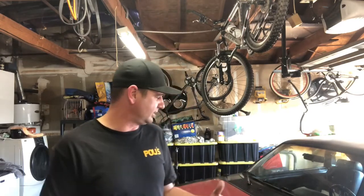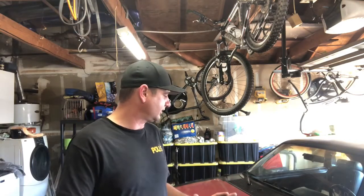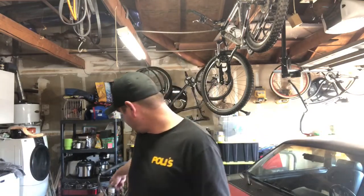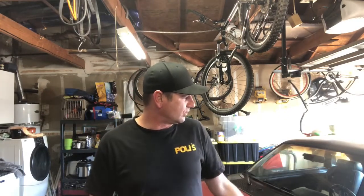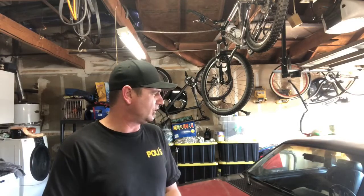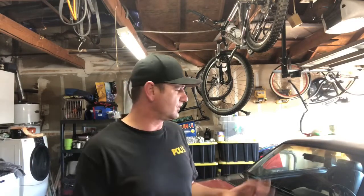But basically, what this allows me to do, with confirmation that that's the problem, is start taking everything off. I am taking the fenders off. I'm going to take all the side skirts off. I'll probably even take the back bumper off. I've got some reshaping to do. We get some sagging in the urethane. I've even got a little spot to do on that front bumper there. And I've got to align the doors with the rest of the body. And then we have to do the fenders and just align everything, shim everything if necessary, all that good stuff. Get this body as straight as I can.